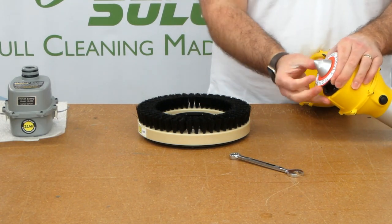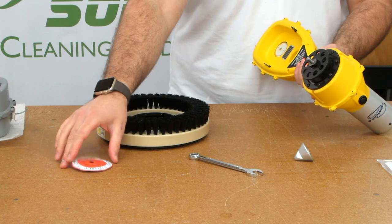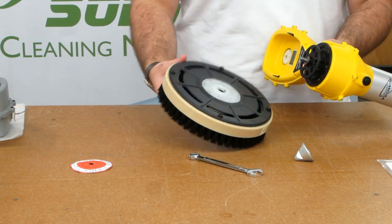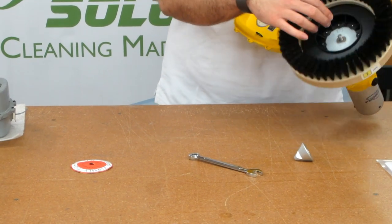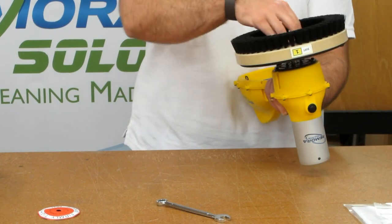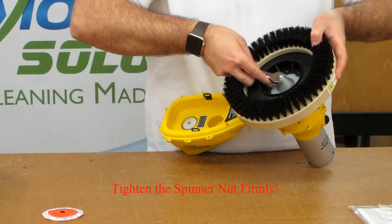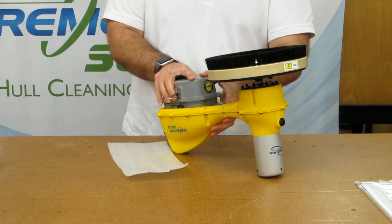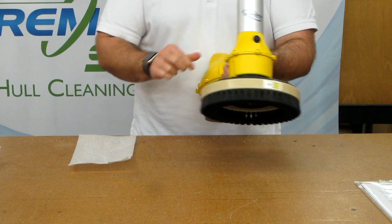After the battery is fully charged, we'll install the brush. Remove the spinner nut — don't get any anti-seize paste on you, it's dirty stuff. When seating the brush, make sure the flats on the drive hub align precisely with the flats in the flex plate. Slide it in place, make sure it's aligned correctly, and thread on the spinner nut. It's very important to make sure that the spinner nut is tight — tighten it firmly. Install the fully charged battery into the unit, press firmly into place, latch the clips, then test operation.